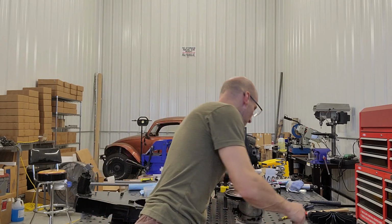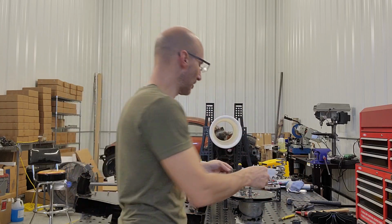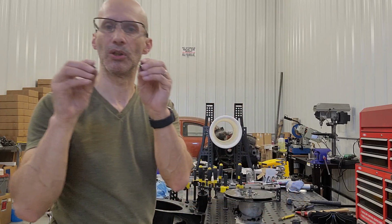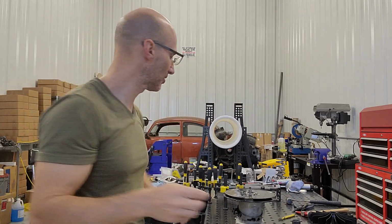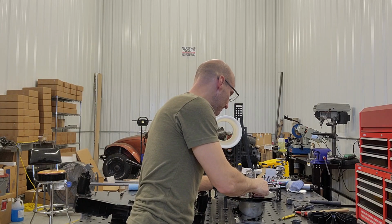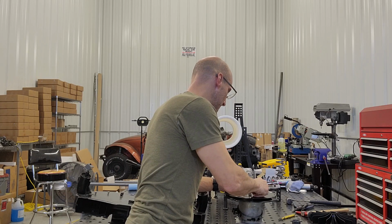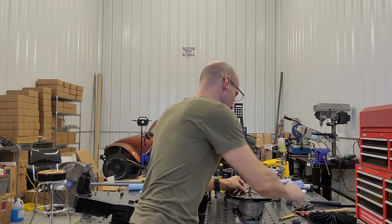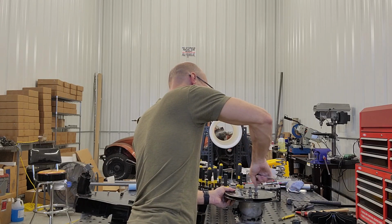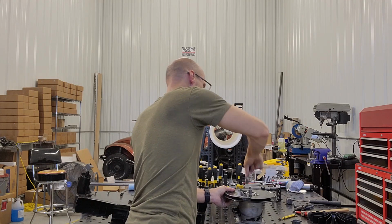So you put those on, and then we have two little spring washers. That's what comes with the OEM, and 2 6mm, 10mm outside hex nuts that go on. We'll just put those on. And these just need to be hand tight. They have spring washers on them. You don't have to do anything special to keep these tight.